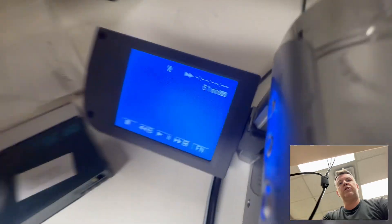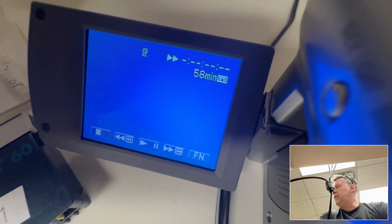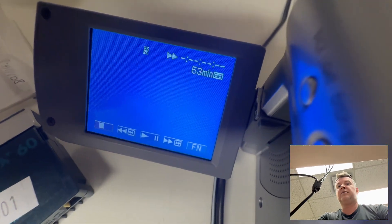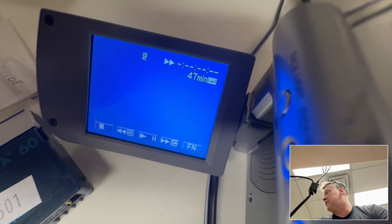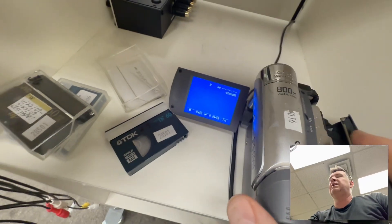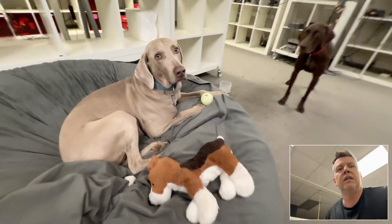Same thing — there is an inherent problem with this tape. If the counter isn't reading, it's not picking up a signal. This tape has probably deposited oxide on the heads. I've got to clean this one and the other one — just putting one tape in can completely clog the heads. A tape cleaner might clean it, otherwise you've got to take all the sides off, get the tiny little screws, get in there, clean it with acetone multiple times. And then you know, I bake them — I'm baking tapes more and more now.